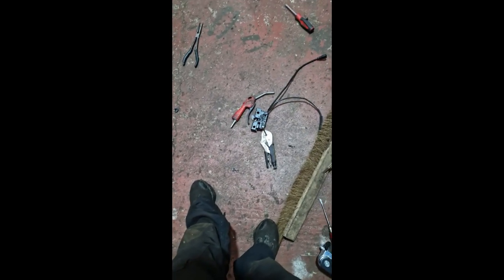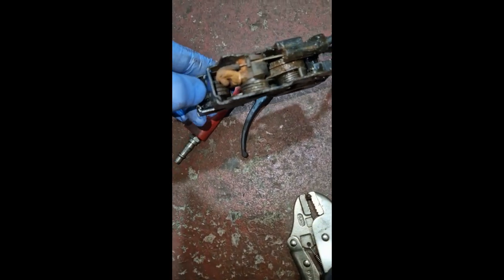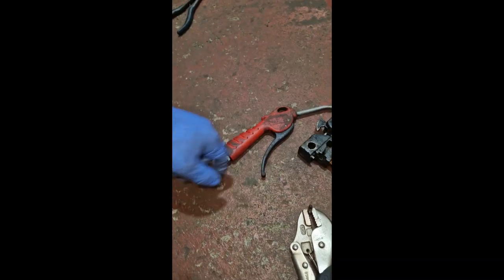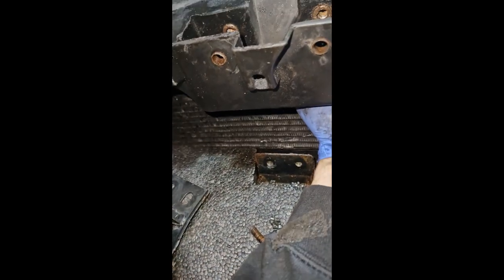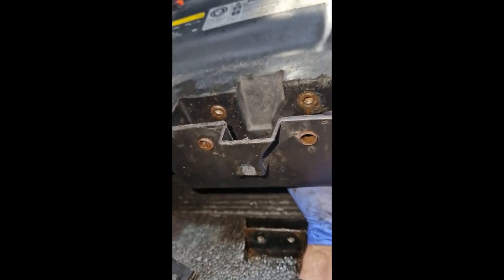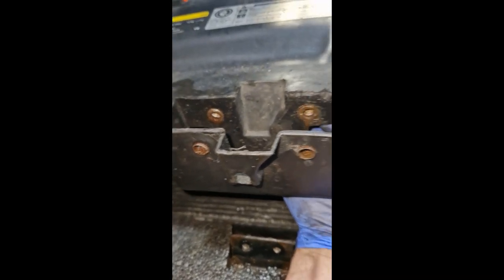Right, so eventually. So Scirocco, you can just see how rotten that is. No wonder it was going to fail. So, lack of greasing, stay the bolt. I've still got a socket actually jammed in there. There's a 9mm jammed up the back in there. So I've tried a swan neck deep, 8mm, 10mm, I'm just gripping it.